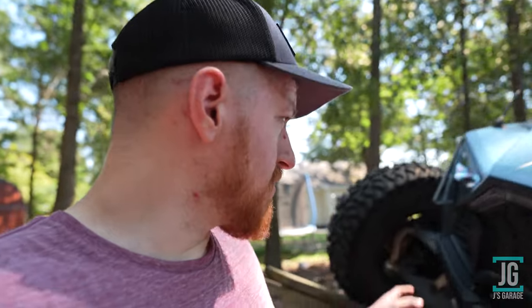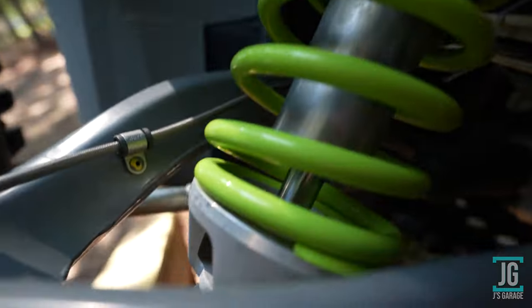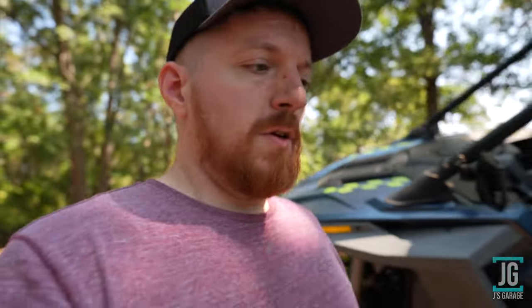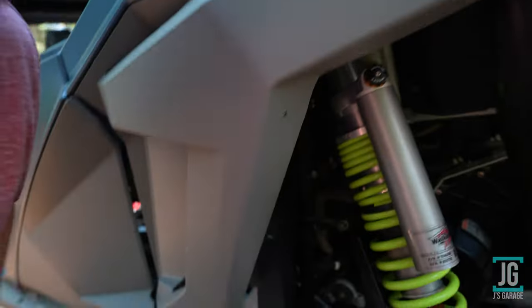All right guys, it's kind of hard to get a tape measure in there, but from what I could roughly see with the measuring tape, we're just over 2 inches away from bumping out this side that's compressed on the ramp. So under more ideal circumstances, could be looking at full compression, which would be a little bit more articulation. And then here on the back, we're not on the bump stop yet either.